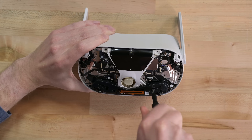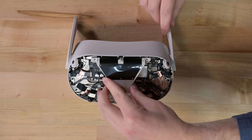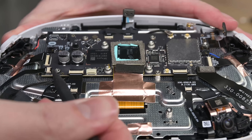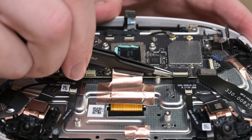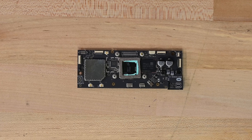After that, I'll remove this big black antenna with eight more Phillips screws, then the fan, and this cute little heatsink. Next, I can start disconnecting cables and free the motherboard. Remember, this thing is basically just a smartphone — look at how tiny the board is.